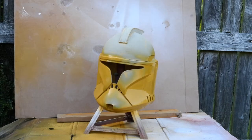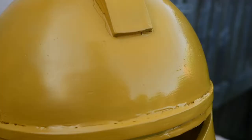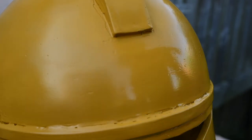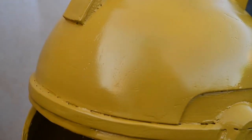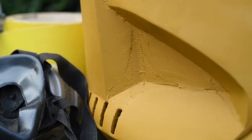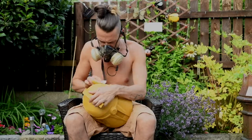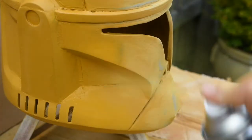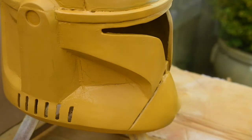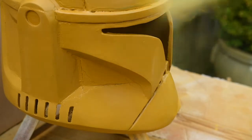With a layer of stopper and then another layer of filler primer, it's actually looking pretty good — but you can still see little scratches and imperfections. That's what filler primer is really good for: highlighting those so you can just add more filler. But these edges and corners are just terrible. By this point you're hoping to have a really good base surface and just be finding scratches to fill — you don't really want to be doing major work after you've already done a load of sanding. All I'm doing is finding the areas where it's all crumbled, sanding them down a bit more to make sure there are no more crumbly loose bits, so I can fill it all over again.